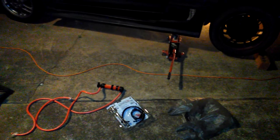It doesn't have any gas whatsoever. Plus my car was parked leaning down this way, so all the gas moved down to the gas tank. So I'm thinking there's no gas around the gas line either, for the past few weeks that I've been leaving my car dry like that. I think that's what happened. The car's been dry, the gas line is dry, so I need to fill up the gas tank so some gasoline can go up the gas line to my engine, so I can crank the car up. That's the cheapest way I can think of right now to get my car cranked up before I get into any other problem, like buying a new starter or new batteries.